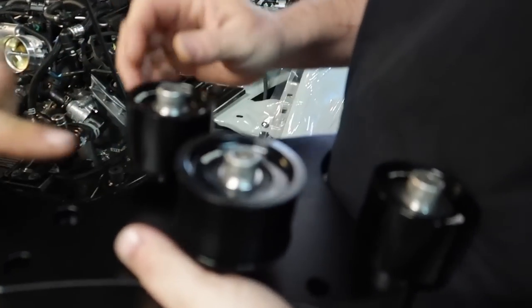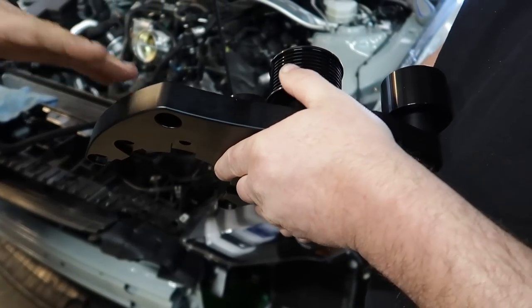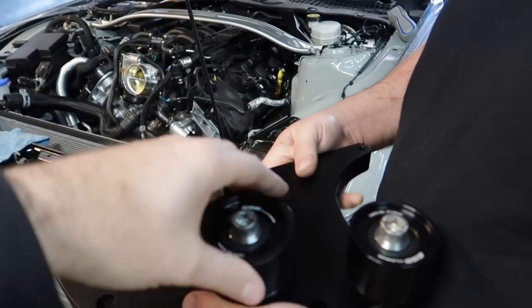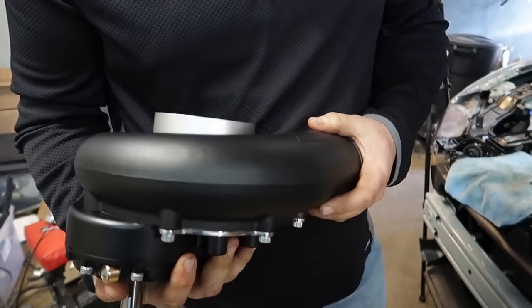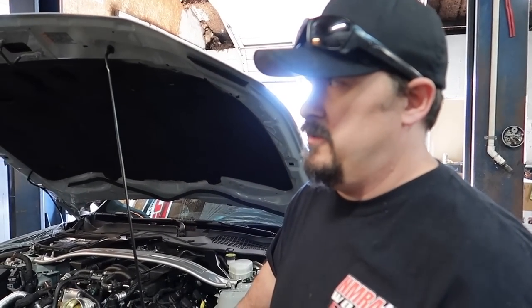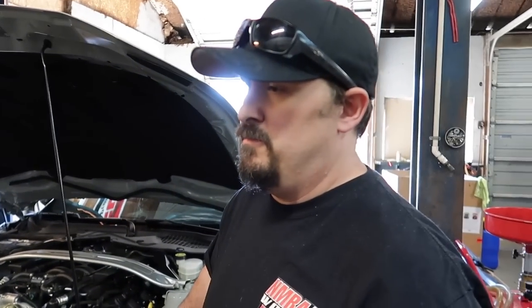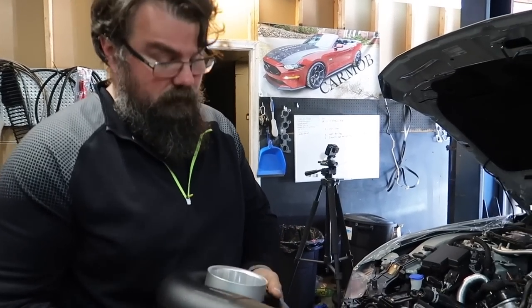But I like this right here that comes already with a 10 rib kit partially installed, and you can still run the 6 rib on it. That's pretty sick. So this is stuff that you don't have to spend on later. I think it's 1600 CFM. That's what I looked at. Yeah, it's 1600 CFM. For the size this is pushing out a lot of air. I know the Vortec V3 JT is, I believe, 1450 CFM. So this flows more than a V3 JT. I'm actually liking it.